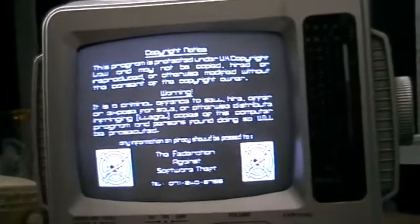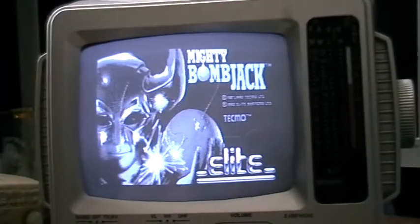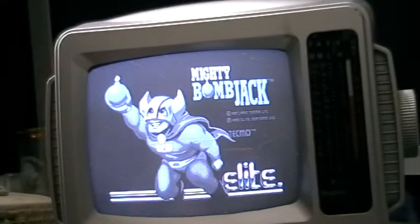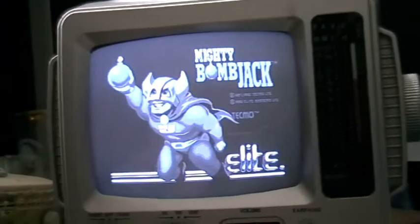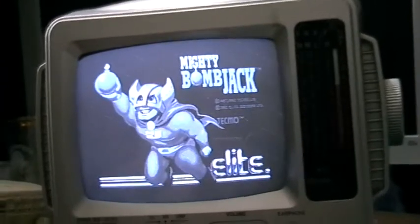So far I haven't recognized any problems with the PC drive. I really only had to change the drive select from drive 1, which is standard for IBM PCs, to drive select 0, which is standard for the first drive for everything else.